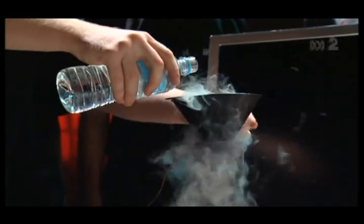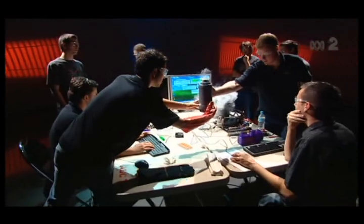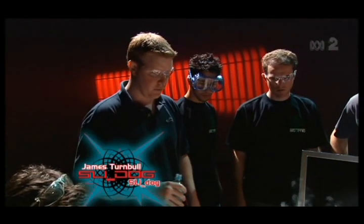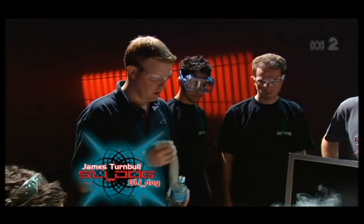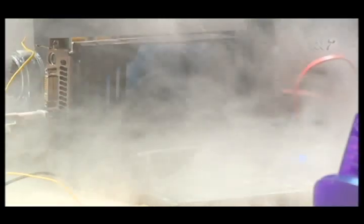It's 165. So why are you adding water into the system? They can quite often cold bug, so if you put a bit of water in, it's a really good insulator and it stops it from reaching quite as cold where it will lock up. It puts a bit of a barrier between the liquid nitrogen, the copper tube and the CPU.